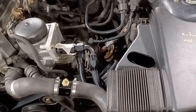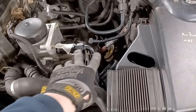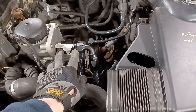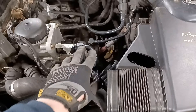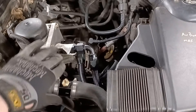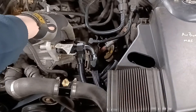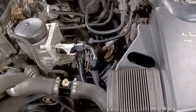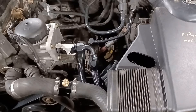There's no way of getting that air hose past this oil takeoff. So this would work if I didn't have this inline fitting here for the pressure takeoff. I'm going to have to take that out and move this joint back onto the end of the thing coming out of this side plate. The other alternative is to put that piece down there, but I still think that's going to get in the way because it'll bring this hose further round and impede on the air box hose.